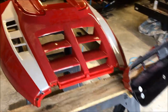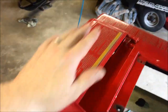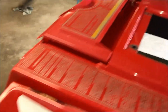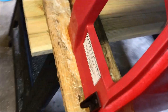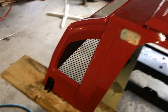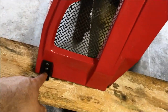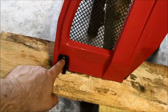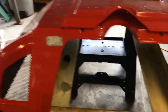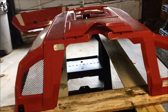Now we need to remove all the decals on the hood and also remove a separate assembly piece. Any manufacturing stickers have to come off too since you need to scuff those areas for paint. For the pieces that are riveted on, I'm just going to tape over them — I'll be lazy on those and tape them off rather than drilling out the rivets.